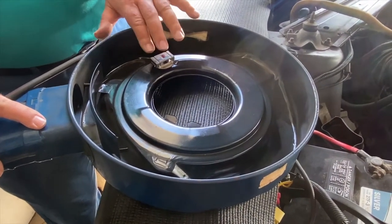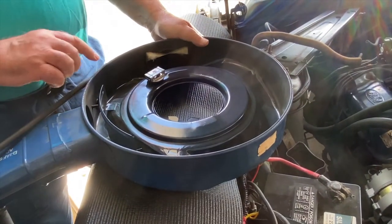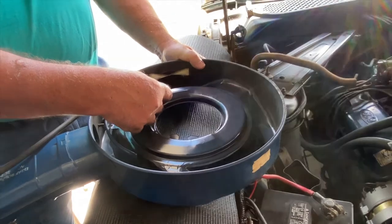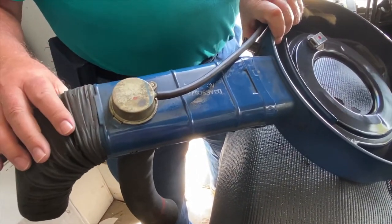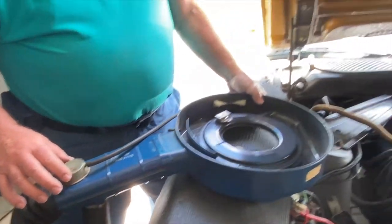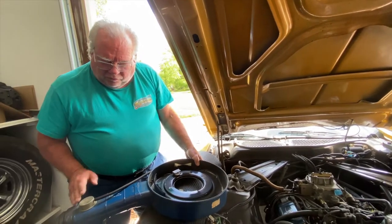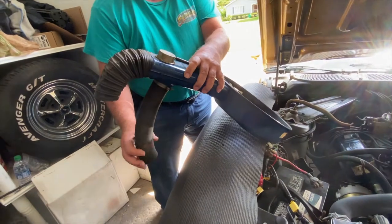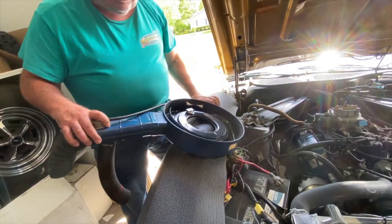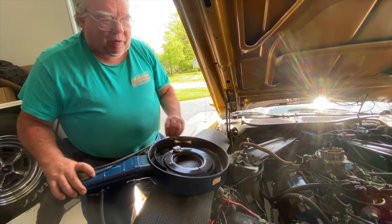On the top side, we have a unit here that is thermally sensitive. When the engine is cold, one port gets vacuum from the intake manifold and then sends a vacuum through this vacuum line with a red stripe that goes up to this little vacuum motor. When the engine is cold, the door inside here — controlled by this little vacuum motor, this little flapper valve — closes off fresh air from the outside and points it to this corrugated tube that goes through the exhaust manifold to provide warm air.